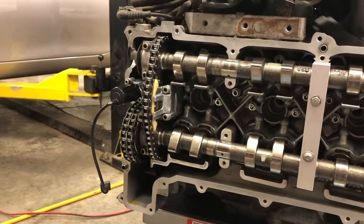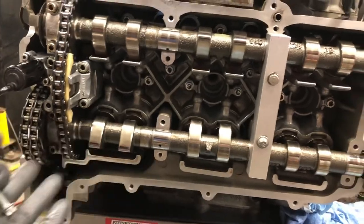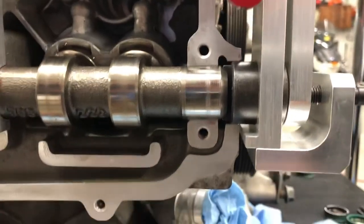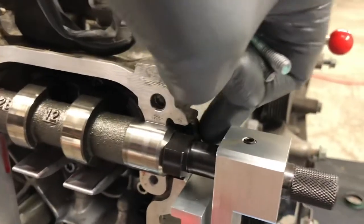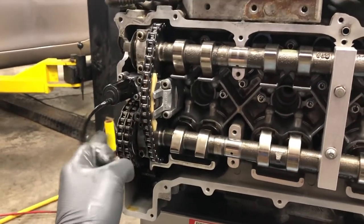The purpose of the VarioCam solenoid is to phase the cams, but given that the exhaust cam is driven by the intermediate shaft, which is therefore driven by the crank, this is the cam that needs to be aligned with the crank. The way the special tool works is it has a groove that slots right into the slot on the end of the cam. Once that goes in, this arm here just has to be touching the end of this little lobe. Once it is, you know that this camshaft is perfectly flat and level relative to the crank.